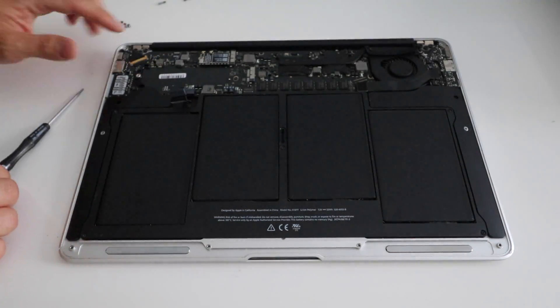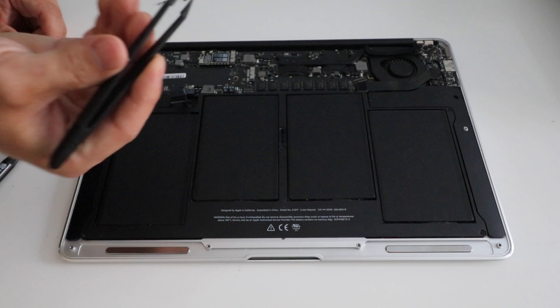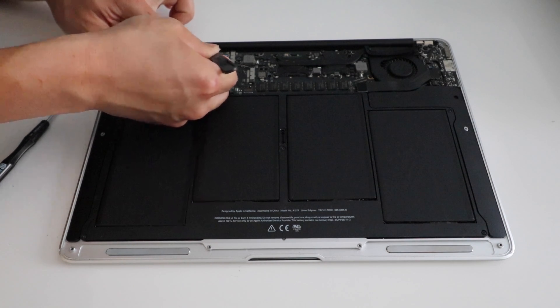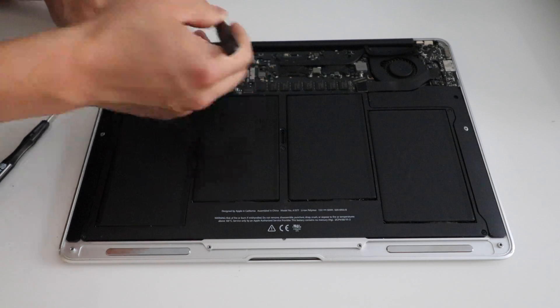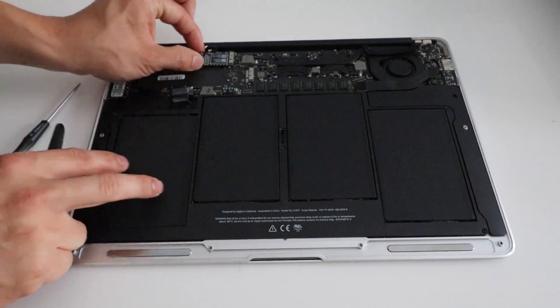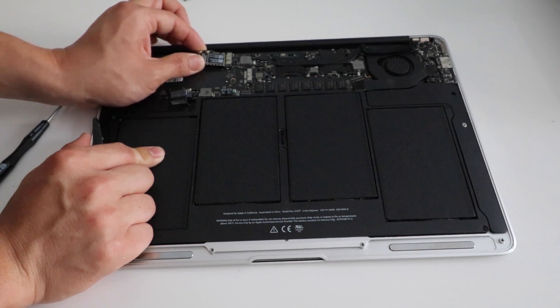Also this is a WiFi chip right here. I'm going to use this tool that's basically like tweezers and just take off the two antenna connectors first. Then there's also another screw that's very similar to the solid state drive — you unscrew it right there and then peel it right out.